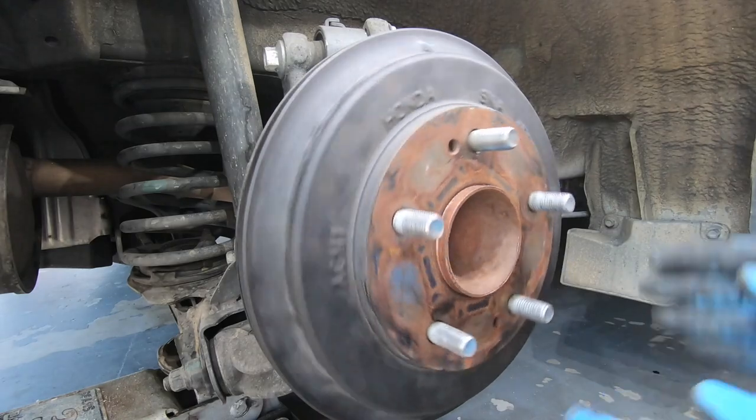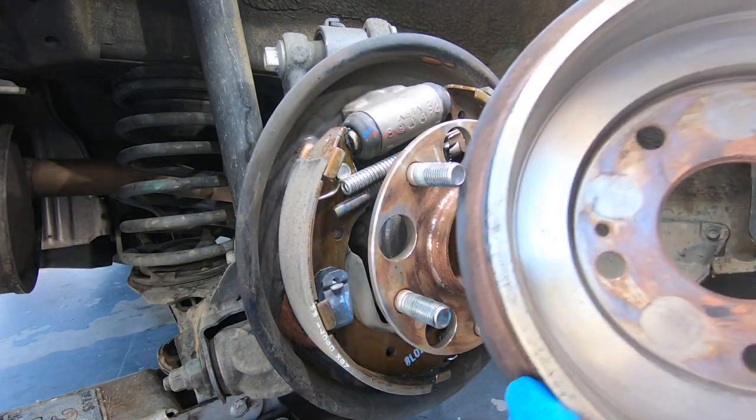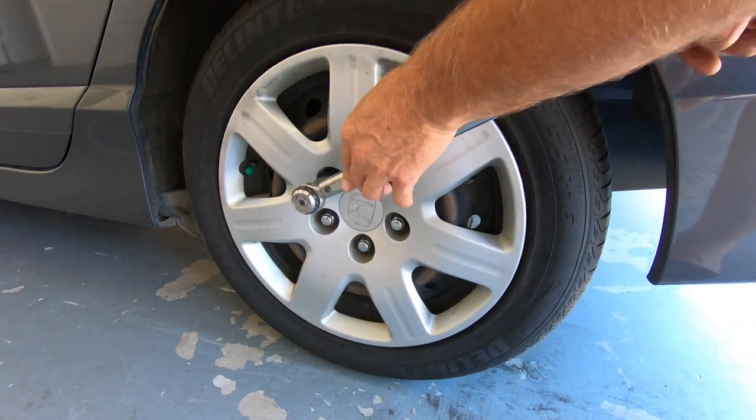Right now I'm feeling a little drag and that's perfect. At this point we're done — those are adjusted properly. It's clean, the pads are clean. The last step is to go ahead and torque the wheels to 80 foot-pounds. I'm out road testing the car now. The brakes couldn't feel better. Every time I stop it's nice and smooth, not grabby. The rears are grabbing just as much as the front — just a perfect scenario. So once again, if you watch my video and follow my steps, you're going to save yourself hundreds of dollars. Thanks for watching my YouTube channel — go ahead and subscribe.